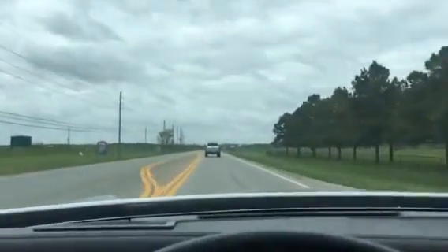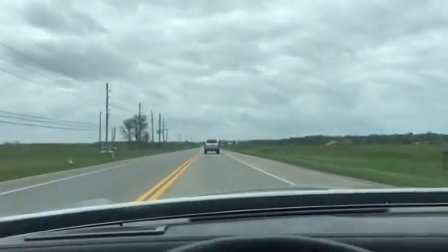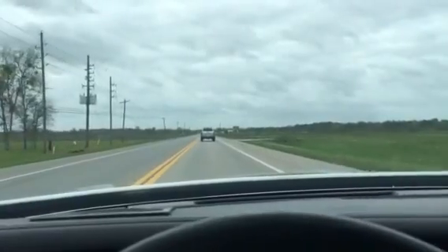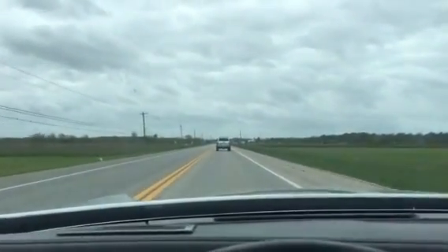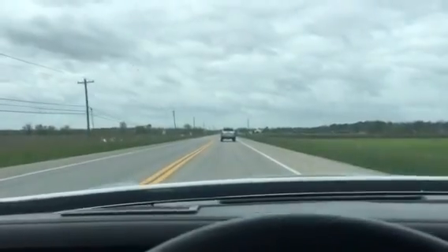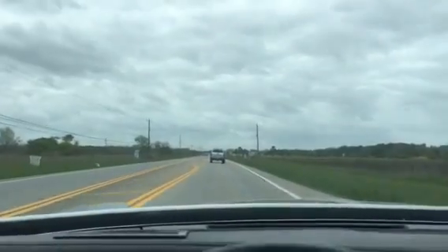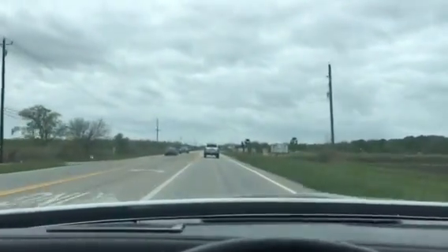What's happening now is when I take off from a light, the carburetor will often backfire — sometimes so hard that it will slam the choke flap shut to where you have to go and pound it open again. Sometimes you can catch it and it doesn't slam it shut, but it gets to be a little bit hard to start afterwards.